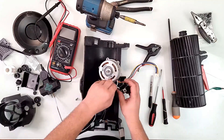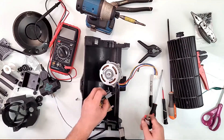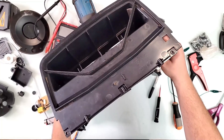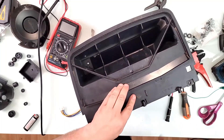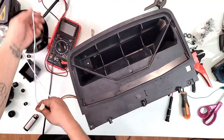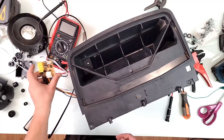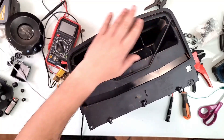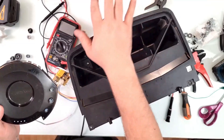I'm very happy with what's going on now. I just have to close these two parts — sleeves are put in place and now we are finally closing it. The whole enclosure looks good; these parts here will be put together when I add the top. First let me plug it in and see the spinning and air situation. Always make sure it is unplugged when you're handling these parts, because this can reach up to 270 volts.